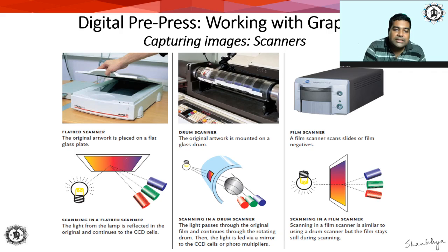So this is the glass, so your document is facing downwards, that is facing the transparent side of the glass. Now this is some illuminant, this is throwing some light onto the document and the reflected light is being captured by a series of photosensors. So for a flatbed scanner, we know that we are using CCD sensors, right? And there are color filters available which will differentiate between the various wavelengths of light that is incoming or that is getting reflected off from the surface of the document.